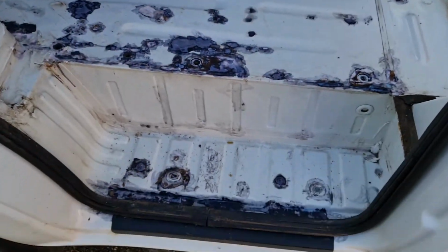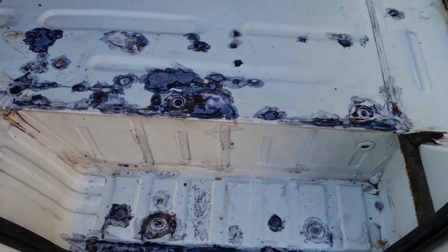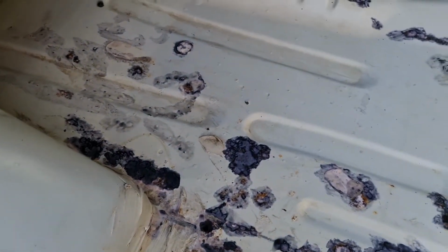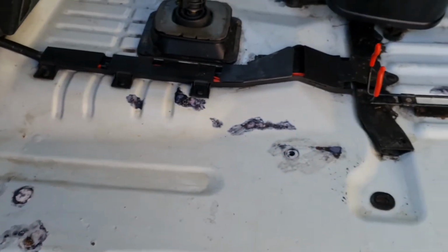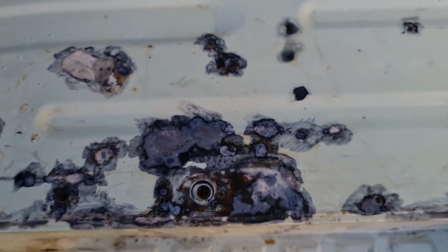We are back, and to finish off this video, I'm going to be doing a few more bits today with Sam for the van. I didn't show you once we rust treated the floor yesterday, me and Sam, so let me show you that, and I'm going to tell you what we'll be doing. Alright, so hopefully you can see. This is where we rust treated the floor yesterday. We put the stuff on and it dries like black, doesn't it, Sam? Yeah, when it's black it means it's finished reacting and it's not rusting anymore, it's all good to paint over.